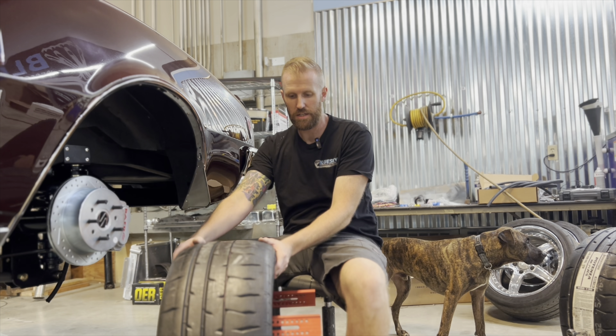This tool will slide back and forth to get your backspacing perfect. Rule of thumb: you usually want about a half inch of clearance to the inside, maybe a little bit more, because we don't want the tire to contact the inside of the wheel well. So we're going to go ahead and set it up to where it feels good. Now that we have our wheel and tire on our fitment tool bolted to the car, I'm actually going to remove the coilovers so that I can cycle the suspension — I can put it at full compression, full droop, and articulate the rear to make sure that through the full range of suspension movement the tire isn't contacting anywhere.